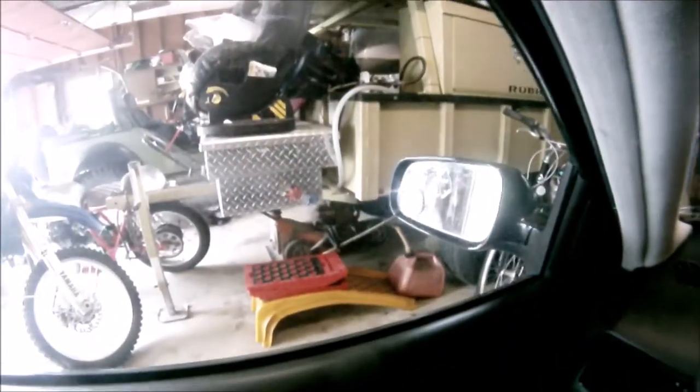I'm going to do a Flashzilla video. I got this Flashzilla and they gave me a Stage 2 and Stage 3 tune, because I wasn't sure which one I wanted to run. I've been running Stage 2 and it works pretty well. I was getting quite a bit of smoke, but we just adjusted the IQ, so I'm thinking that will be down. I want to see what the Stage 3 feels like. I'm running about 18 pounds of boost consistently once it spikes — it does spike up to about 20 or 21 and then goes down to 18 or 17. I finally got my little boost gauge installed.